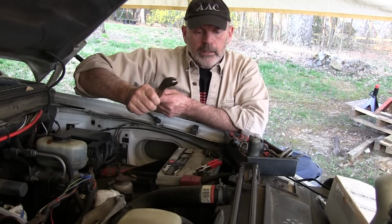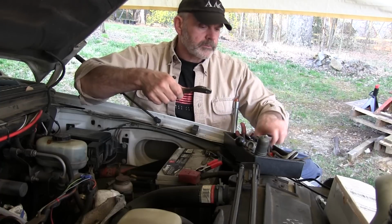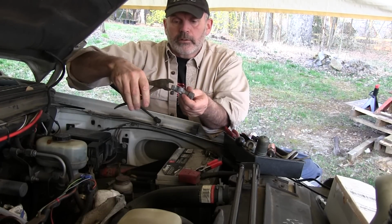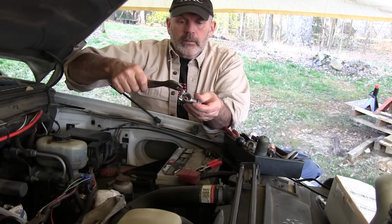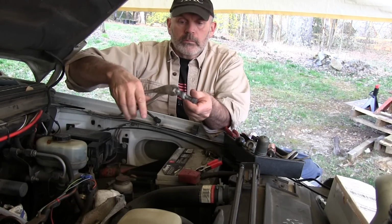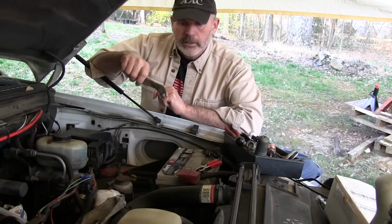These are legitimate battery terminal pliers. Now I'll have to use one of these new ones here. Where are they? They're designed to fit right on these square bolt heads on the battery terminals, so that you can turn this side loose with a regular wrench. Sometimes the terminals are corroded, and you can use one of these on both sides, and it fits pretty well. They actually work so well that you can use them on the regular bolt heads without damaging them. I've used this for decades, so that's what I was using during the video.